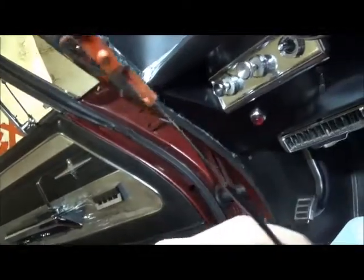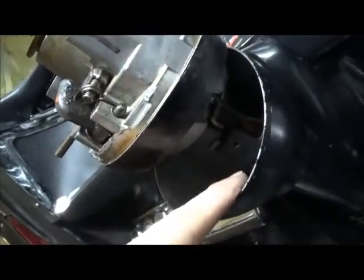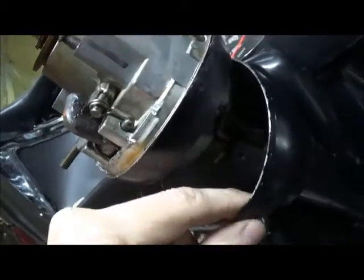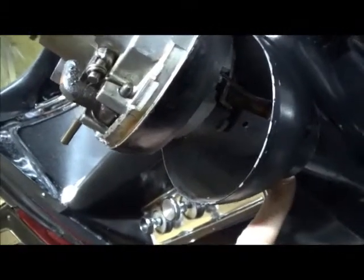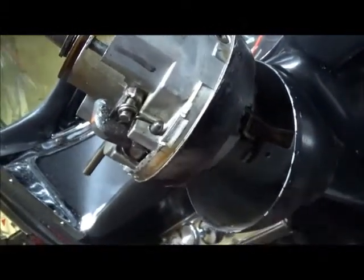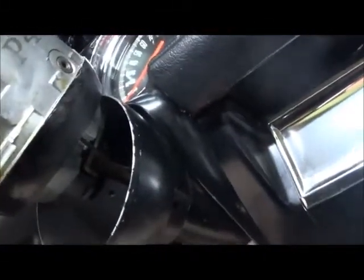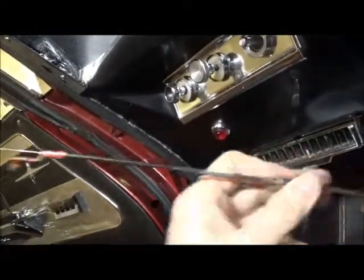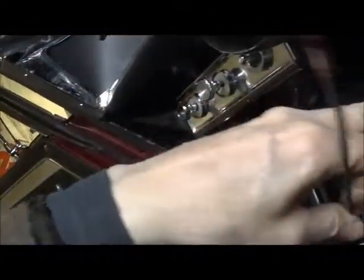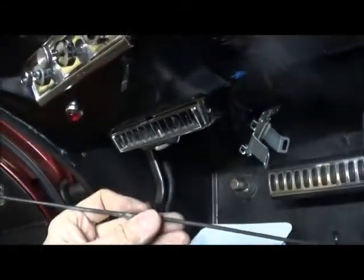You're going to have to get this collar loose - there are either two screws in the base or one screw, depending on how they did it. This one has two, the other one has one. The steering column also loosens and drops down, then you can withdraw the cable down and out, and now you can work on it.